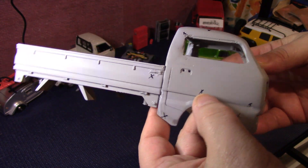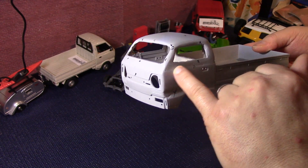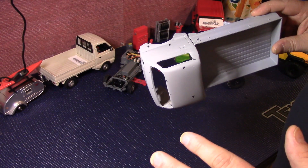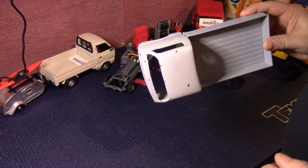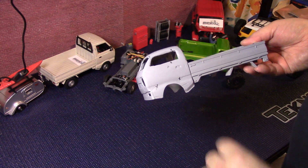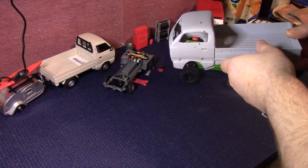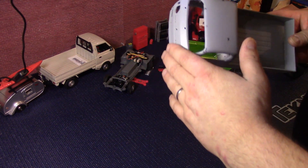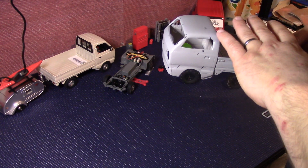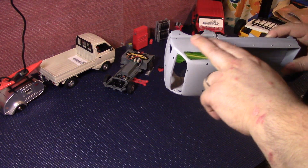They're all over this thing — little X's where I need to go back and wet sand or put the body filler in to get the little craters out. I don't want to go totally perfect on this, but I'd like it to be as perfect as possible without driving myself insane. I'm going to try to do as good as I can. Wherever these X's are, I'll wet sand all of this again — this is the second coat of primer.